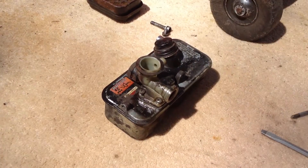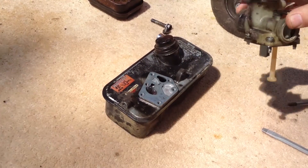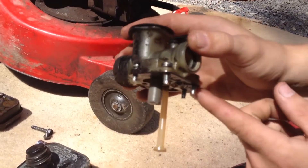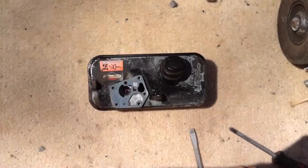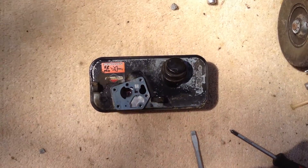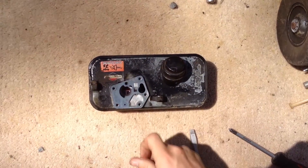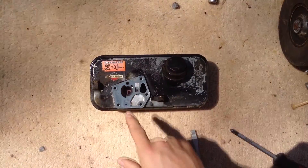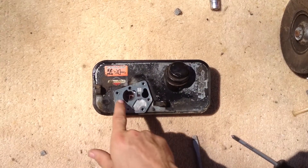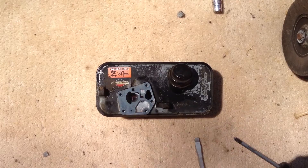Be mindful that petrol will spill. The diaphragm is still connected up top — we'll look at that in a second. Here's the bottom half of the carburetor, which is incorporated in the tank. The main bits to clean are this area here, the holes, and the main jet hole where the fuel is sucked up. It's important that there's no dirt stuck in the holes or in that main jet, as it can be sucked into the carburetor filters and block them.